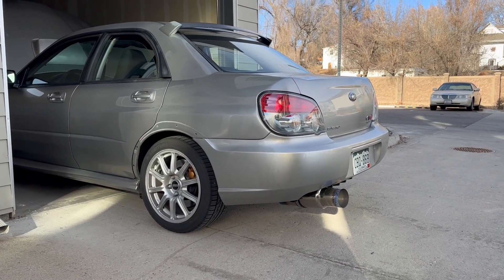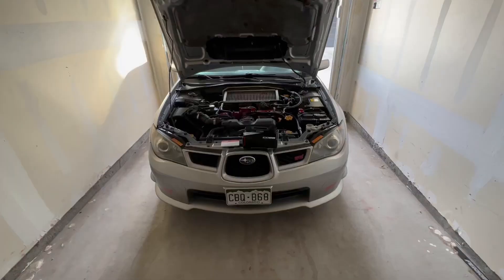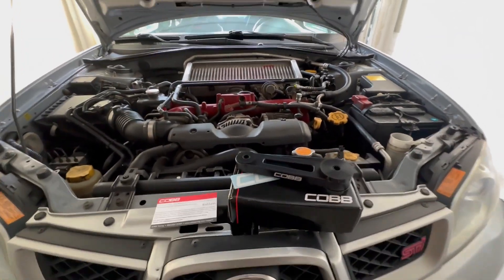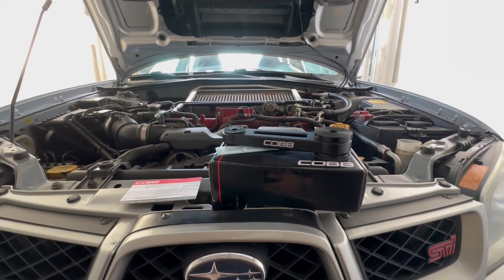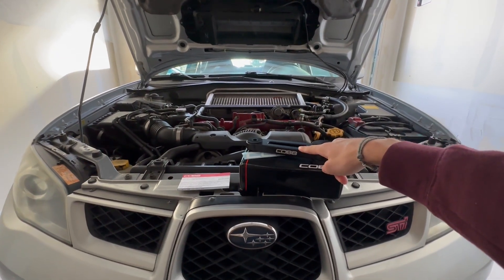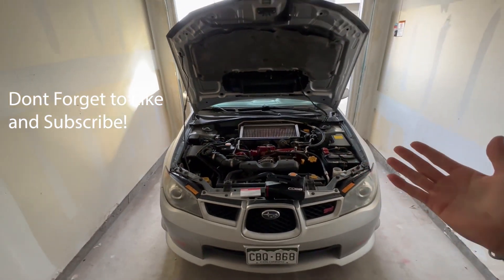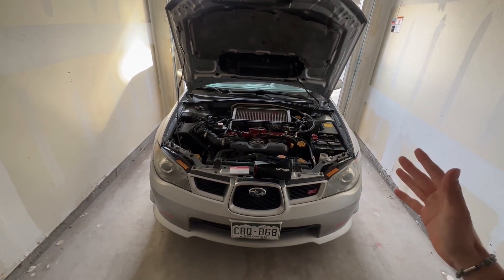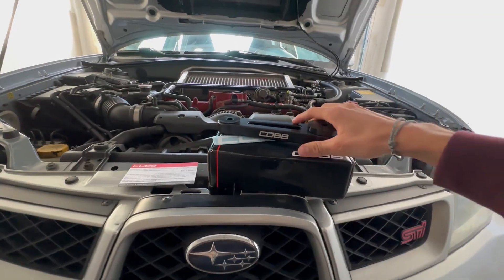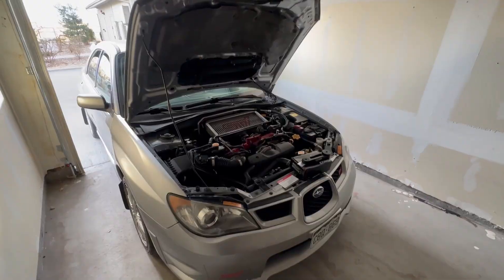Welcome back to Boost Feed. Today we're talking about a super crucial mod that is super important to every Subaru WRX STI model — the pitch stop. The pitch stop is a very crucial mod that I think gets overlooked easily. It sits on top of the transmission and connects to the back of the firewall. The stock one that comes with every manual STI is super flimsy and slim, which allows for a lot of flex, whereas companies like COBB make a very thick, dense, heavy metal one that reduces flexion and allows for cleaner and crisper shifts.